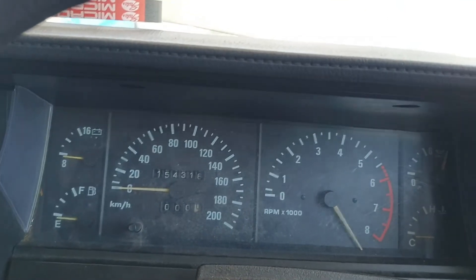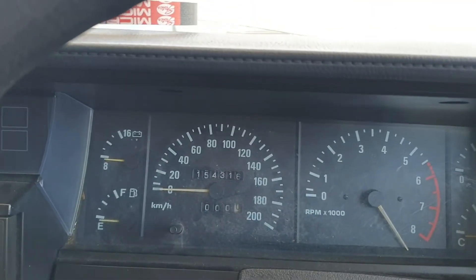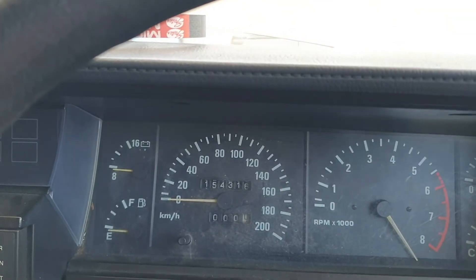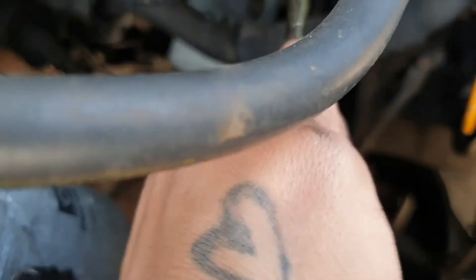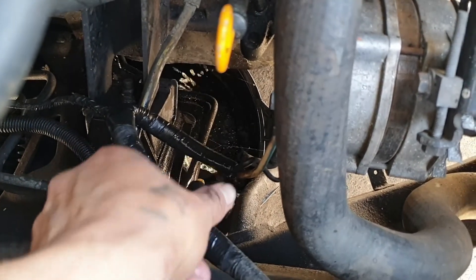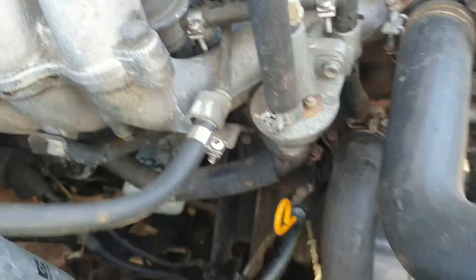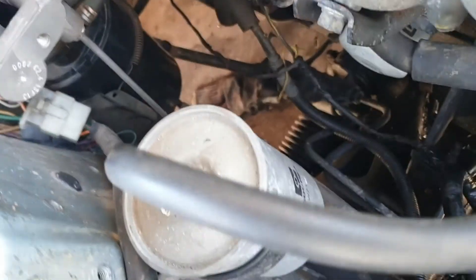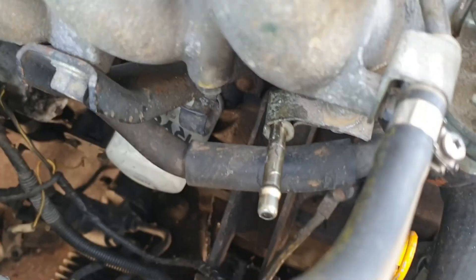Give it some throttle — see what happens. That does not sound good. What the f**k. I just remembered I was spraying the whole engine with water yesterday, so maybe there's water in something now. The fuel in the line looks pretty feral — it's quite rank and stinky. I'll take off the filter and drain that out as well, and drain the return line. That's just a line from the end of the rail after the regulator, so we'll drain the rail out.